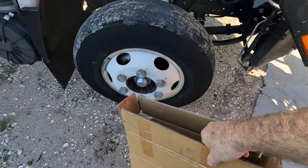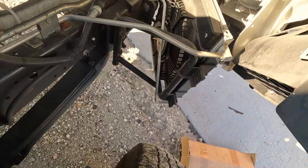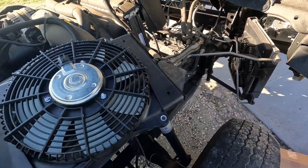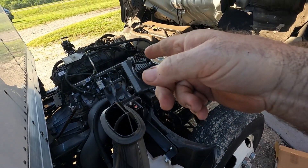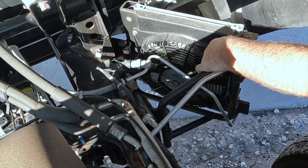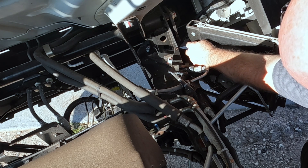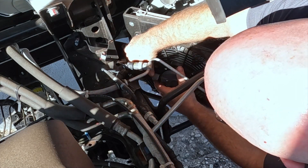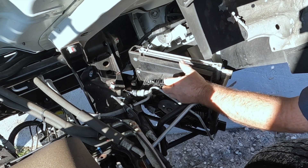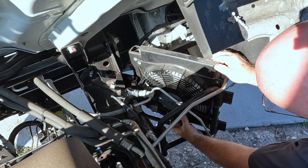First job this morning: Isuzu NPR, got a condenser fan motor — make sure it's the right one. Looks right in the box. Looks like a 12-millimeter, an electrical connector, four little nuts — should be a piece of cake. Get some AC for them. These look like 12 millimeter to 10s. Most come out with a ratchet except for that one behind the bracket up on the right front — gotta get two hands in there. There we go — hope it'll lift out without too much fuss.